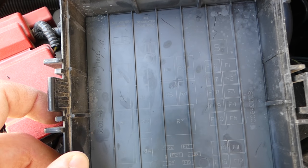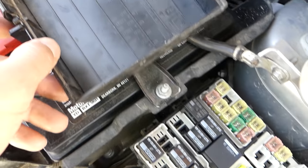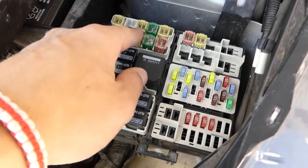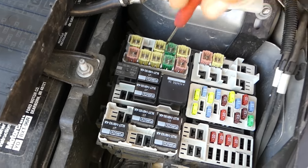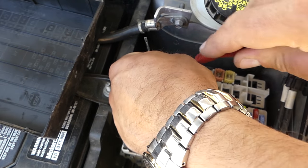On the back side of the cover you can see the fuse numbers. We have fuse number 3 and fuse number 13 that could be for the radiator fan. Fuse number 3 is right here — ours is 60 amp, but yours might be different depending on the model.